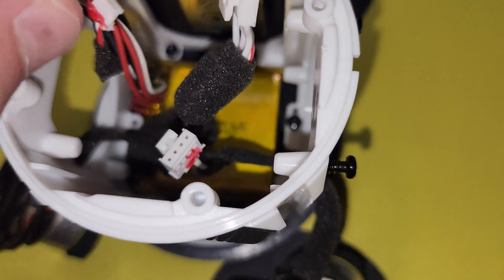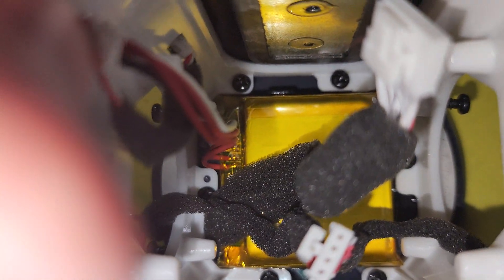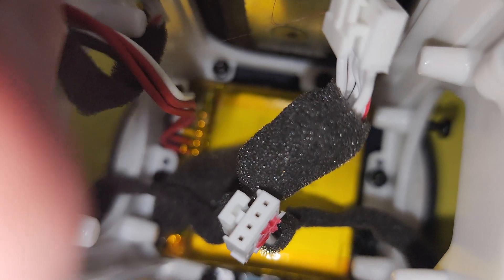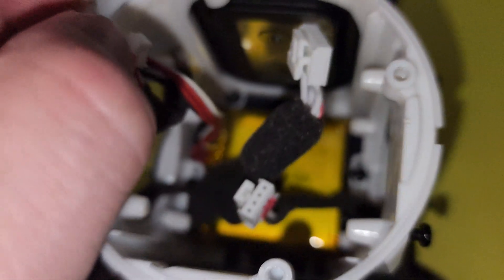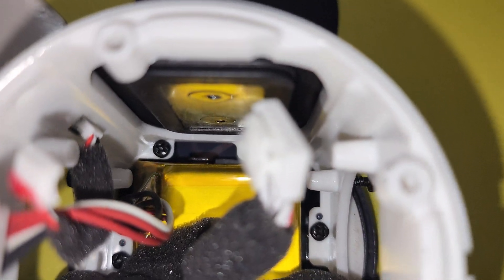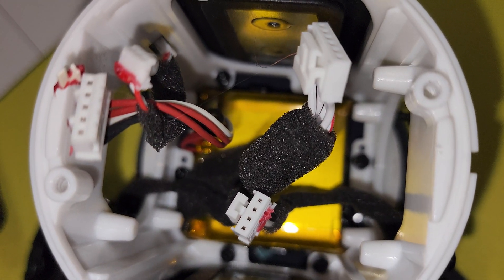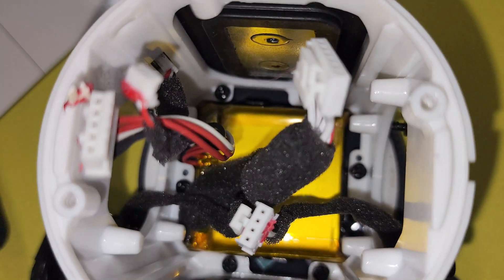It's not very hard to do anything with this right now — you could theoretically try and pull that battery out without taking that bottom plate out by just spudgering it. But it might be easier to take those screws out down there, down there, down there, and there's two down here. Take those out and then you can easily remove that battery.